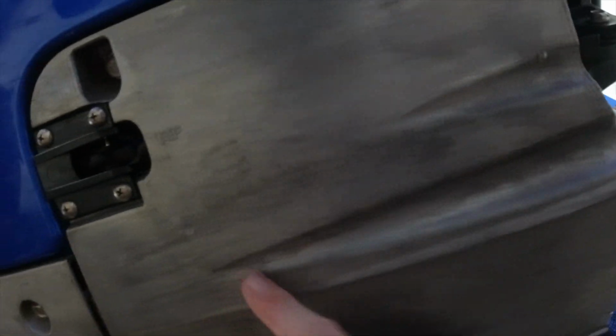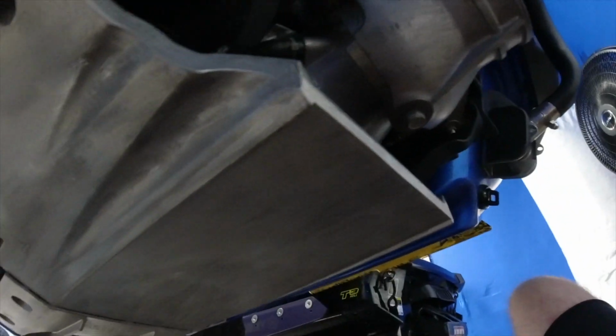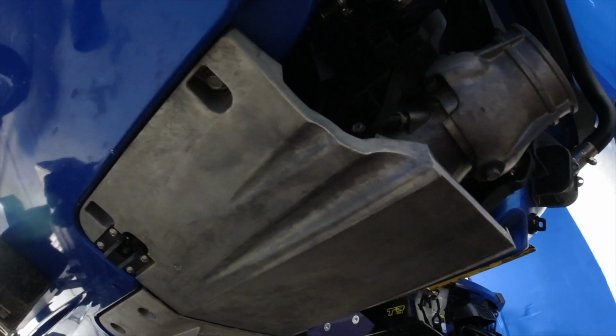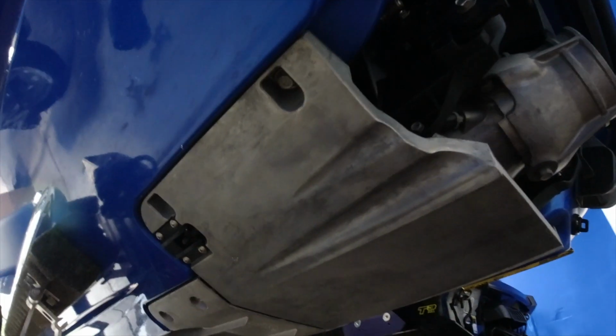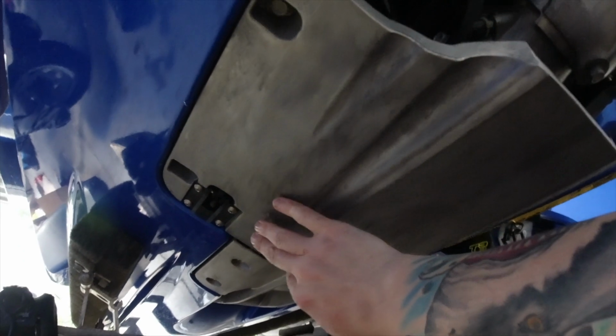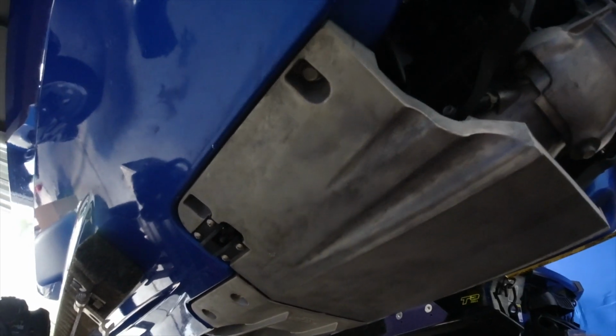Interesting fun fact, the ride plate on the 2019 and up Yamaha GP1800Rs is a RIVA Racing ride plate. It just doesn't have their logo stamped in it. The ones that RIVA sells are painted black. So if you had an older GP1800, you'd want to do the ride plate and intake grate at the same time. Just got to unhook them both. And you can see the pump seal right there. It's all ready to go.